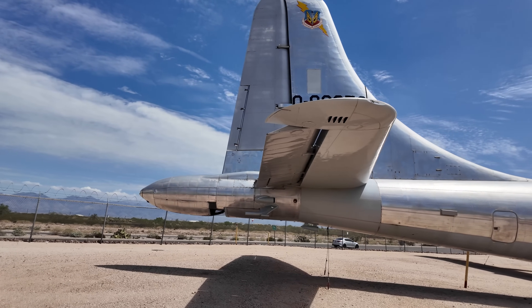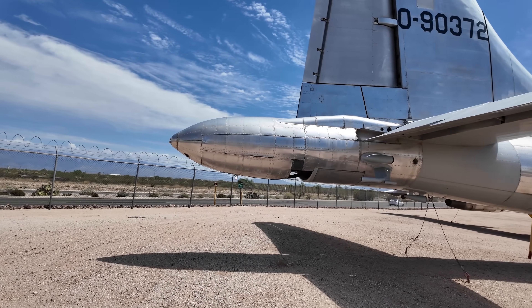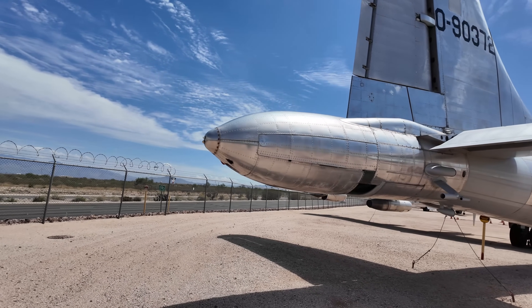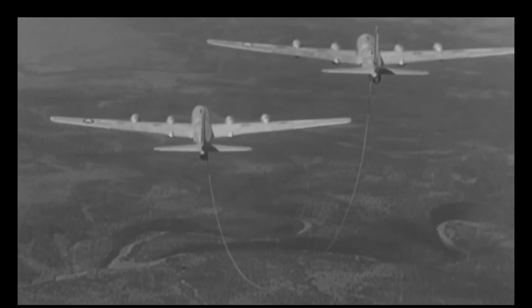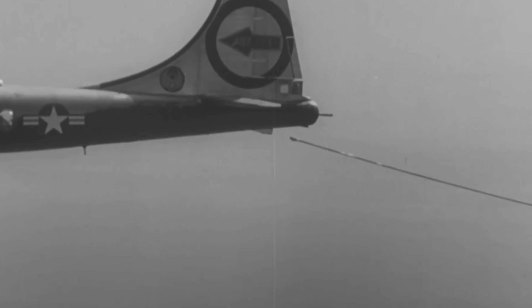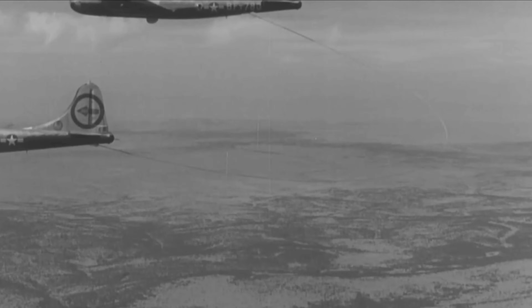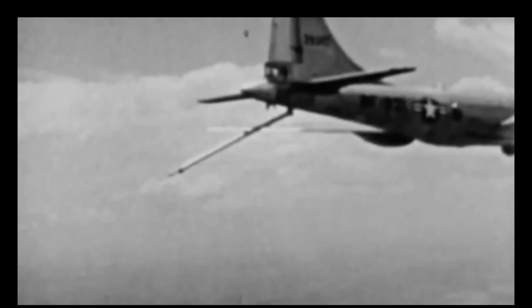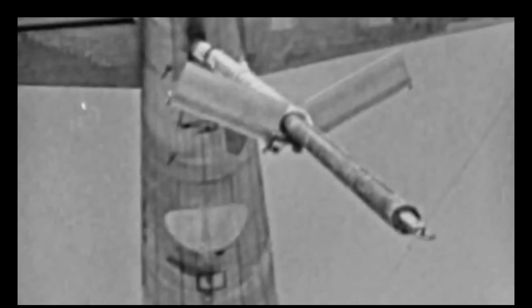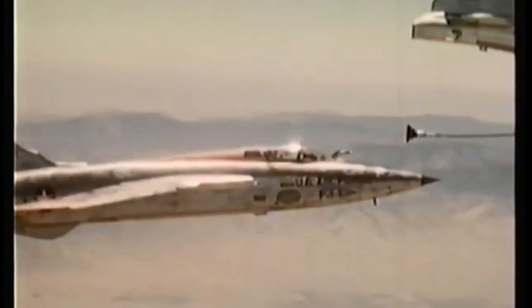This object at the tail was another drogue hose pod. As mentioned, the aircraft approaching it would be exposed to prop wash, making it a difficult and dangerous process. Initially they would have used a loop hose refuelling system where the receiving aircraft would catch a small line from the tanker and then haul over a fuel line. This was obviously complex and time consuming, and a Boeing-designed flying boom method was later introduced. Here the pilots could just hold the aircraft stable and the boom operator would direct it into the receptacle — much easier than attaching to a drogue hose free to fly around in the wind.